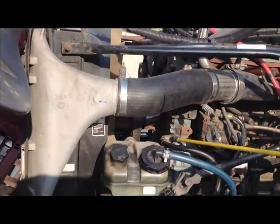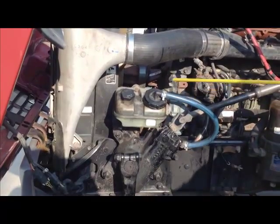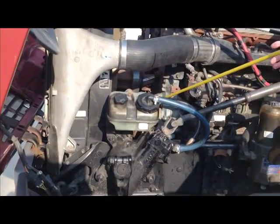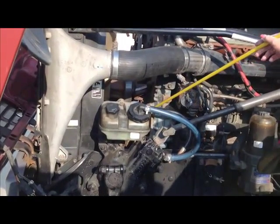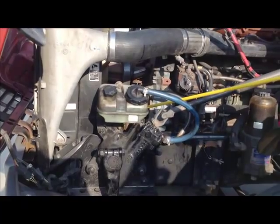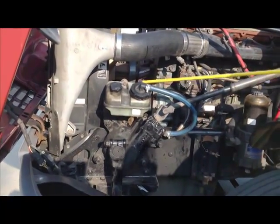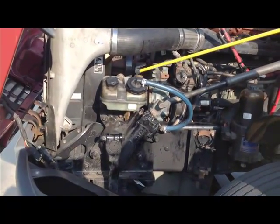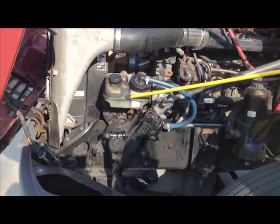Then we're going to go to the power steering pump. If you look at your reservoir, all these hoses run into the pump. You must talk about that. The pump is securely mounted, not cracked, broken, no missing nuts or bolts. It's not leaking. Follow your hoses, not cracked, broken, worn, or frayed, not leaking, to the reservoir, power steering reservoir. It is securely mounted, not cracked, broken, not leaking. The cap is in place and it's filled to the proper operating level.